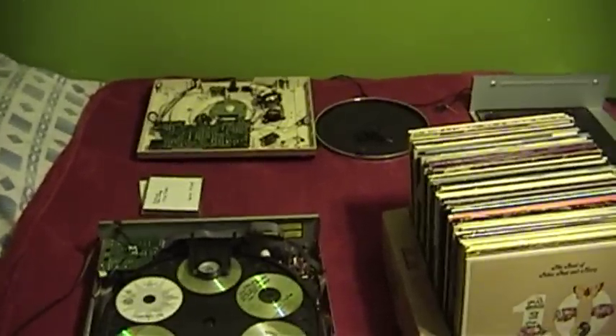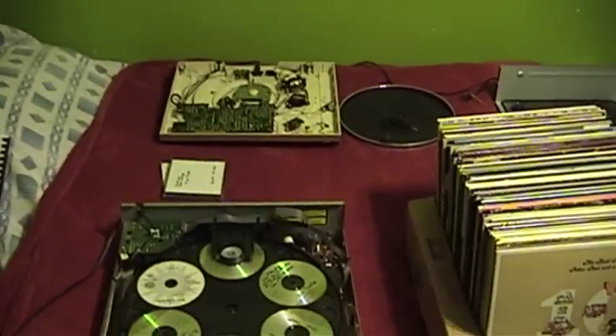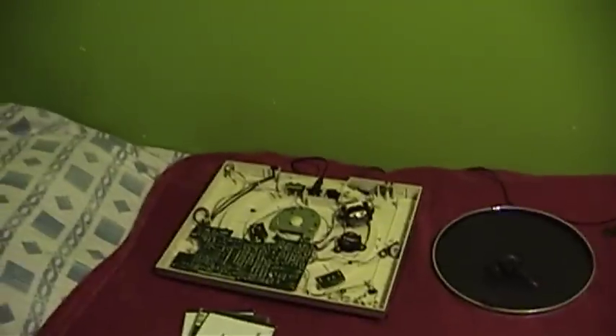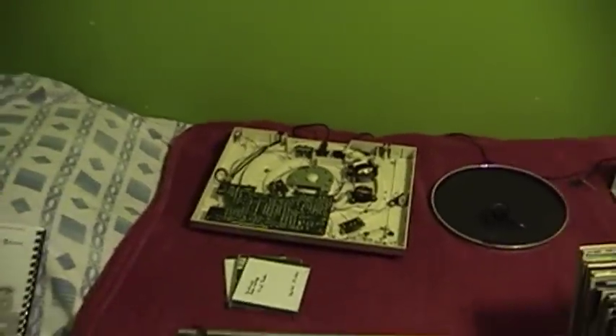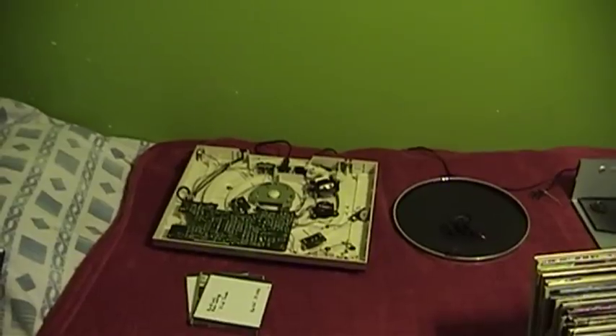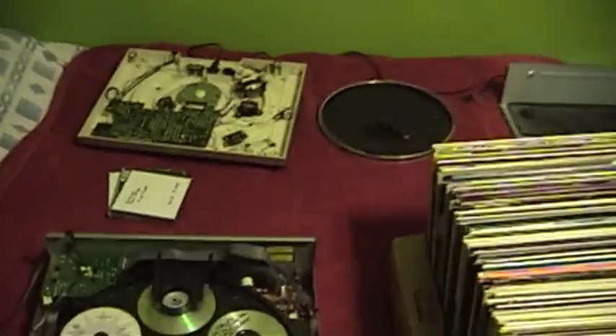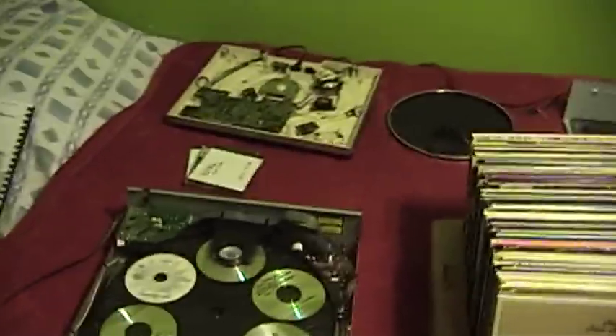I'm also planning to do some set decoration to make things look better. I've got a Technics turntable here that's slightly sick — this is the good old SLBL3 — and the pitch control is giving me fits. I think the control is dirty because the speed will change sometimes slightly but perceptibly during a record, and jiggling the speed control always seems to fix it. So I'm guessing it's dirty or has some conductive gunk in it.